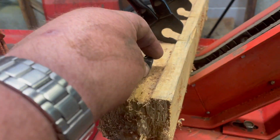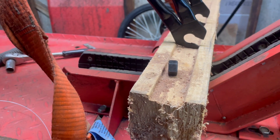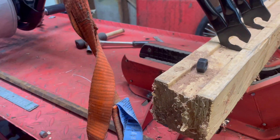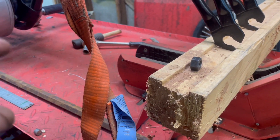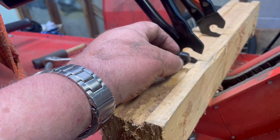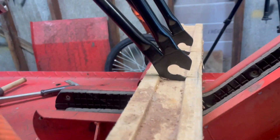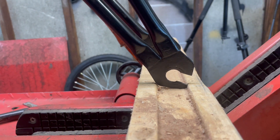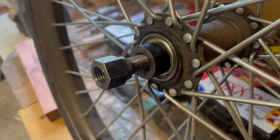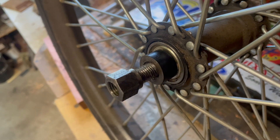The hex bar is a little rusty and dishevelled looking but it's all actually new, so I'm going to make a new nut. I'm going to put a 15.5mm shoulder on the back of it — only as wide as the dropout — so that it goes through and captures the front wheel in the dropout. The only way to get the wheel out is to back the nut right out and let the axle slide forward, so even when the nut is loose it won't let the wheel drop out. That ended up being a frustrating little job — I measured the axle wrong. It's not 7/16 BSF, it's actually 12mm×1.5. Really frustrated with myself; I made one nut and it was wrong.